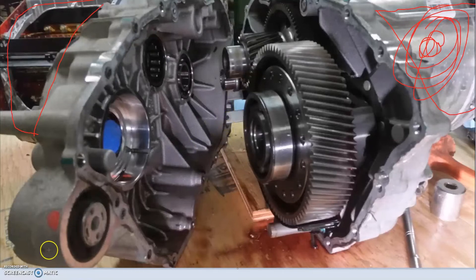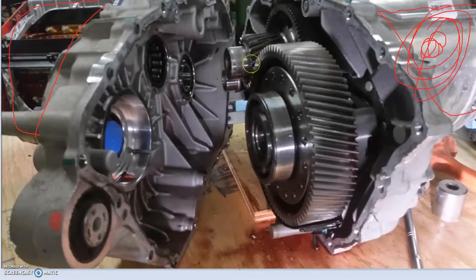You will be able to replicate something similar to a clutch kick, though. People say that electric motor torque is instant, and it pretty much is, but it's not the same sort of instant as bang-dropping a clutch — there might be a 0.1 second delay for the controller to work out what it's doing and adjust timing. An electric motor draws amps — put more amps in, make more power. These motors don't have brushes doing the timing; the timing is done by computer, and the computer can adjust the timing to pull on a certain magnet sooner or later. Through adjusting that timing you can make more and more power, but it'll start to get hot and you'll start to damage it.